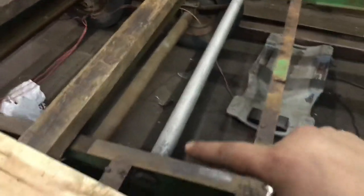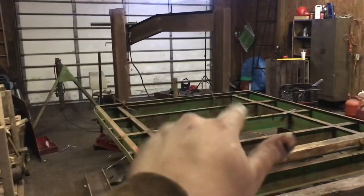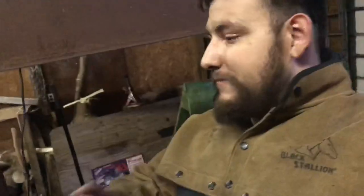Everything's going really well, I'm super proud of it so far. I've got torque tubes put in here — they're like three-inch by quarter-inch diameter tubes I had laying around. I'm welding them in there just to eliminate a little bit of trailer sway. Once I get the deck put in I'm sure sway will be cut down a lot. The reason it's so wide is you really have to tie into the main rails, which gives me more stability side to side and room to put a toolbox in there.